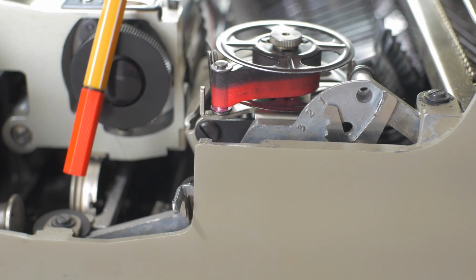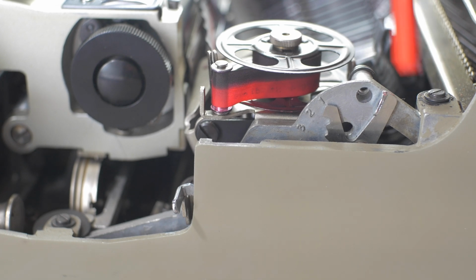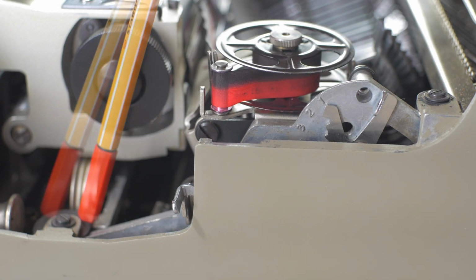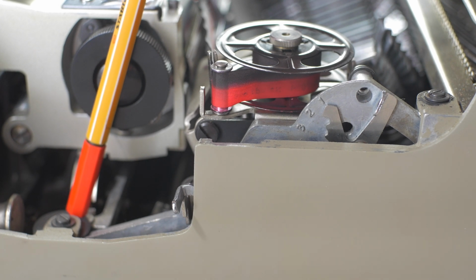So we're going to have to take off this screw, and the 2 corresponding ones on the reverse side. There are also some rubber washers underneath the 2 rear screws. Take those out. Then we should be able to take the body off and get the chassis accessible for our adjustments.